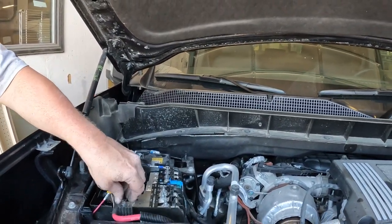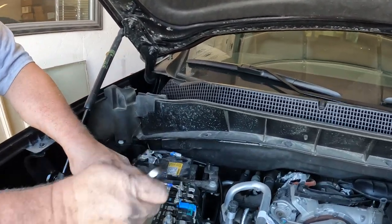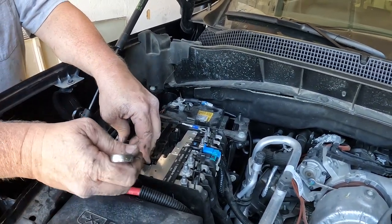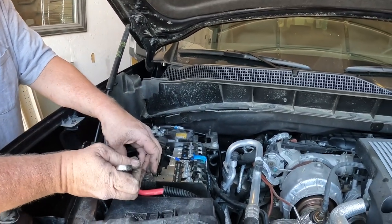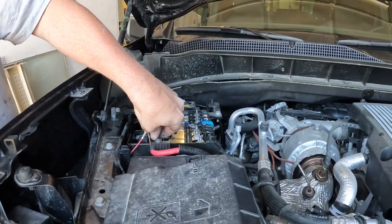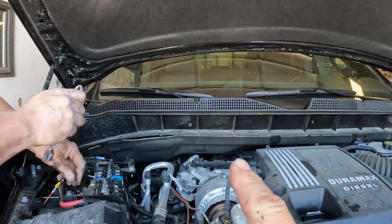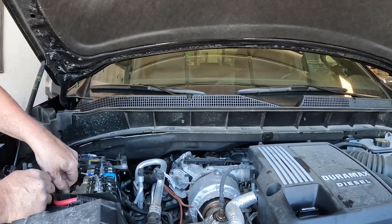Final steps — we're hooking up the wiring. We ran it underneath the body mounts all the way to the back. We have the positive and the negative. We had a cut slot here for the Warn winch and used the same slot to put our positive cable in. We'll run the negative over there. There is a yellow cable that comes in this kit — you do not use the yellow cable. The ground is in the back. We actually used a body mount — there was an existing factory body mount for the compressor ground.